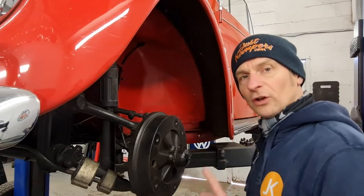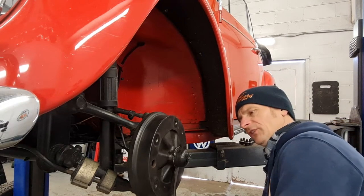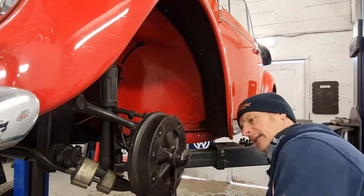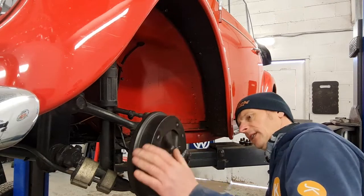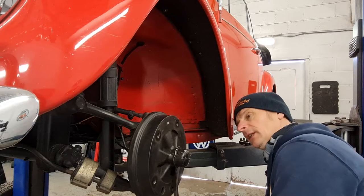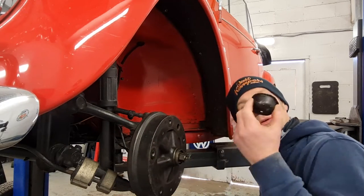Next I'm going to remove the grease cap. I'm going to use a lever bar and just gently prise it off — obviously stand out of the way because I don't want to hit myself in the face. Just a little gentle tap. You can use a block of wood and a hammer; just tap it off that way. Either way we don't want to damage the grease cap, so whatever you do, be gentle.